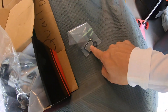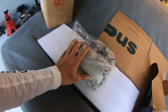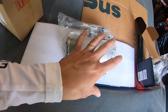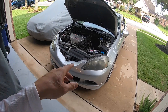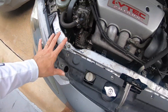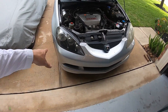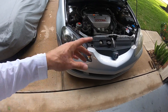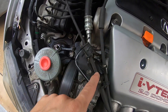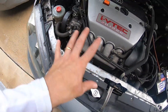Today we're going to knock out this little gasket on the head behind the power steering pump, and I'm going to do an AC compressor. If you check out my last video, I went ahead and diagnosed the AC system — the compressor clutch was on its way out, so I went ahead and got a whole new compressor. If you have an RSX or an EP3, the AC compressor is located way down there and it's really hard to get to. Pretty much you need to take off this piece of the car. To make this easier to film, I'm actually going to take the front bumper off and possibly the headlight just so I can get the camera in there a little better. I'll go ahead and knock all this out anyway since I've got to take the belt off, replace the gasket, and replace this guy because it's leaking at the shaft.